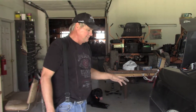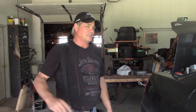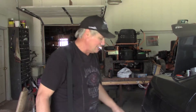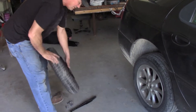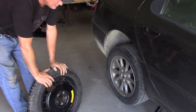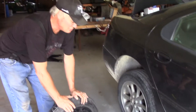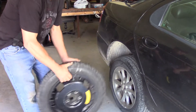I've heard of trying kicking it with your foot, or putting all the lug nuts back on just a couple turns and driving a short distance then slamming on the brakes to break it loose — but I tried that and it didn't work for me. Here's one thing that does work, and this is a roadside emergency tip. It works better than anything I've come across even in the shop — I used to bang these off with a sledgehammer, with one person holding a block of wood against the rim. That worked pretty good but it's a two-man job. This works better than anything and it only takes one person: you've got your spare tire, just wrap it with that and swing it against the stuck wheel.